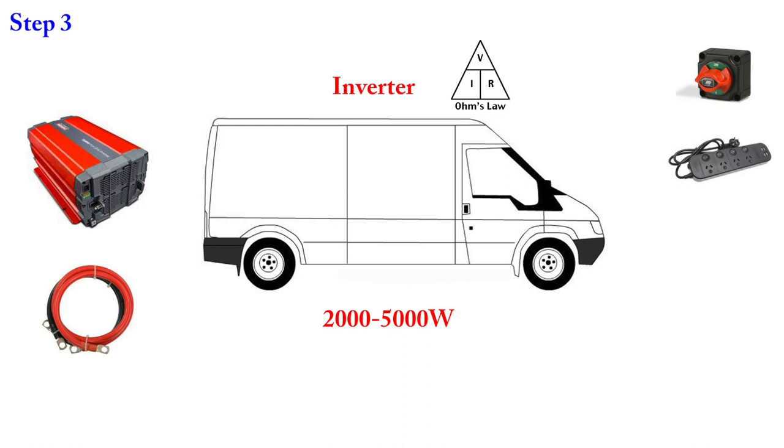The next step is the inverter. Going back to the battery — as many amps as you can get: 100 will do, 150 is better, 200 even better. Now for the inverter, you can't just run anything with anything — it's all calculated. To run the machinery we showed you, one at a time, you need a decent inverter with pure sine wave, not modified wave. You also need to work out what size inverter you need using Ohm's law, calculating how much each machine will pull.